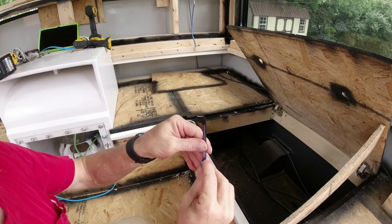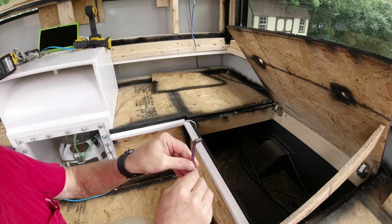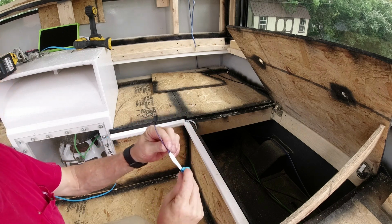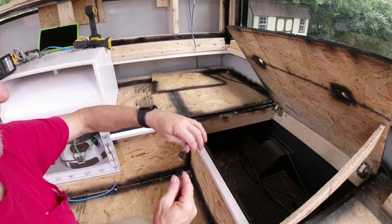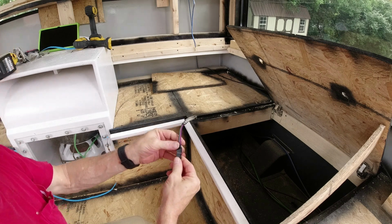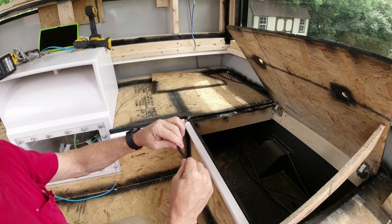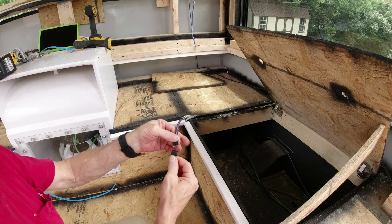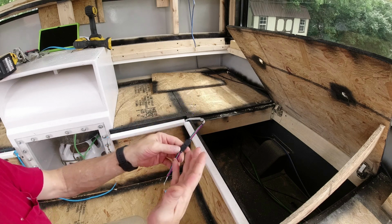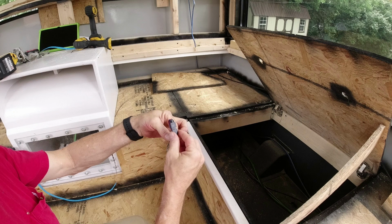These are a little weird when you start out getting these to start. Well, that one was easy, but usually that's kind of a bear. So, peel that back and just stop. Line these up, plug these in. Now, a lot of times I'll put black tape or something around this, because these are jiggling while you're going down the road, so eventually they can come unplugged. So, before it's all said and done, I'll have that all wrapped up in electrical tape, or I'll loop it around or something and put a zip tie on it, just so this doesn't shake apart later.